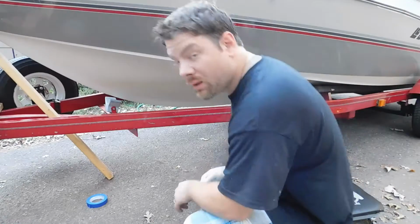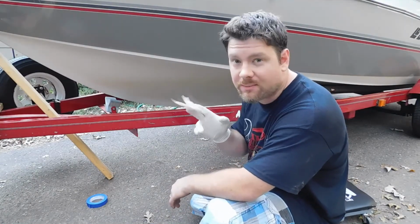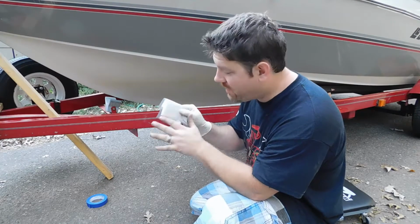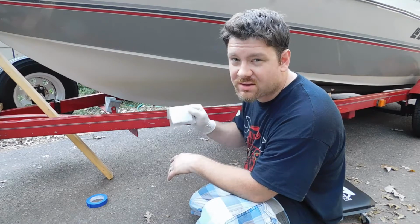Another thing to add, I feel like it's obvious, but maybe I should say it. Once you're done sanding, remove the tape, then clean with this rag. Alright, I just referred to the instructions. This stuff dries almost instantly, and you need to keep this adhesion promoter pad folded at all times to keep it from drying. I have a feeling I gotta move fast, so let's get this done.